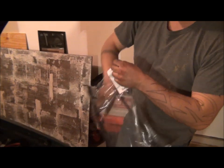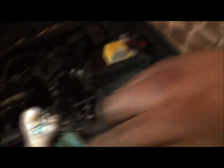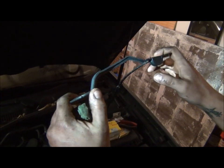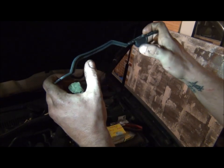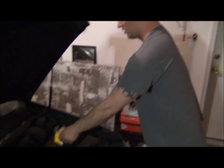The centerpiece is for the spark plug tubes, which was really causing a big problem here — it was leaking on the outside, but not nearly as bad as it was leaking on the inside. Here's the new valve cover gasket. You can see it raises up on the end over by the timing belt and camshaft position sensor. Pay attention to how it raises up and then comes down with a little half moon there. My personal preference on any gasket is that anywhere it takes a drastic change in direction — like up and over and back down at the half moons — I always put a little bit of RTV or Honda Bond or whatever your preference is. It just helps seal on these corners that don't always get the right pressure. So get your Scotch-Brite and clean all that stuff up.